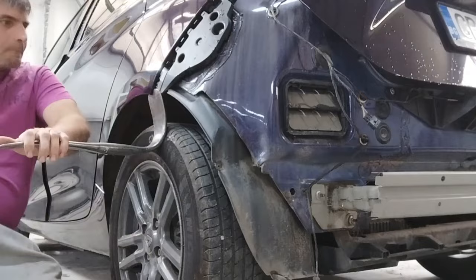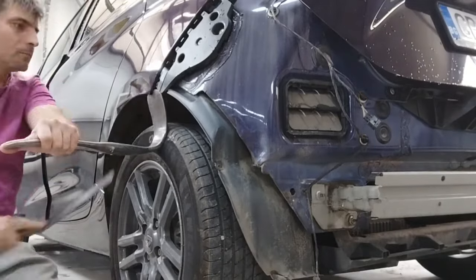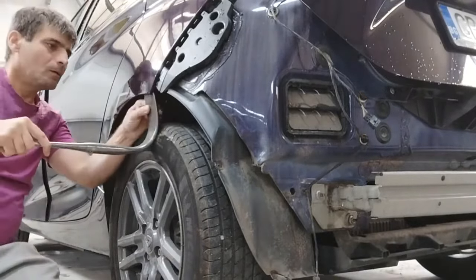I work with the Glasurit 90 line. Beautiful paint. When spraying the base, I want to pay attention to the speed of spraying. I'm not uniform. I don't spray the spots separately with primer. I just spray everything, and I slow down a little where it's needed, so I have a uniform texture. When applying the clear, I will have an even texture.